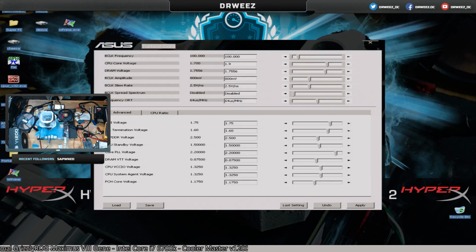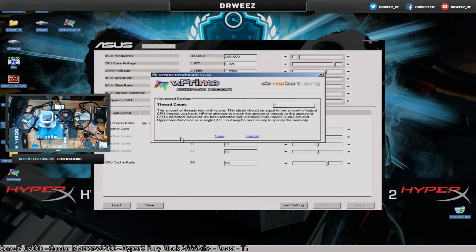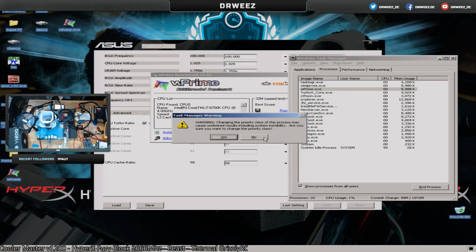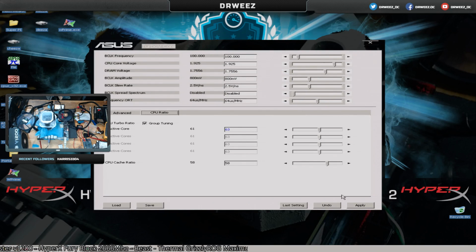Let's go back to 1.9. Then we're just going to push that ratio, and we're going to try and do a 64 run on the first run. Yeah, first run magic, maybe you get a competitive score, some efficiencies, and then we'll set the core count up to that, change it to high, and then let's drop this up to 364. We need to be at minus 177.